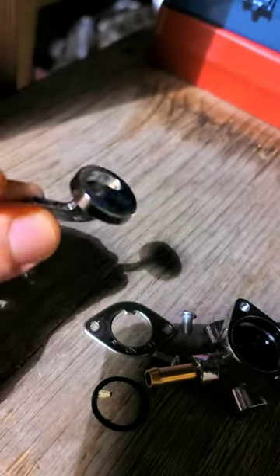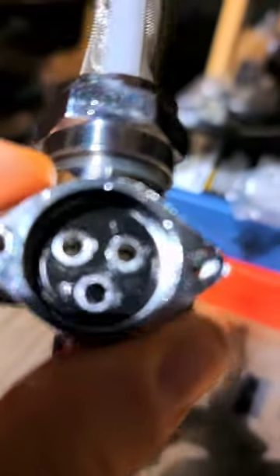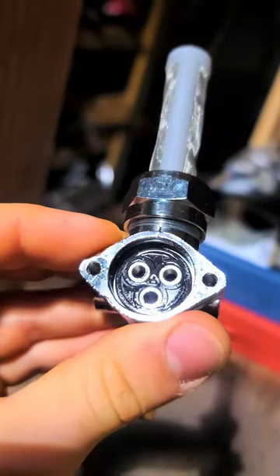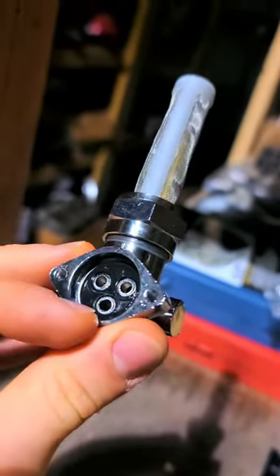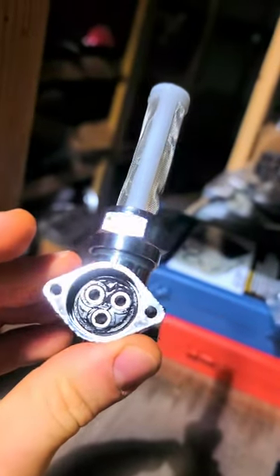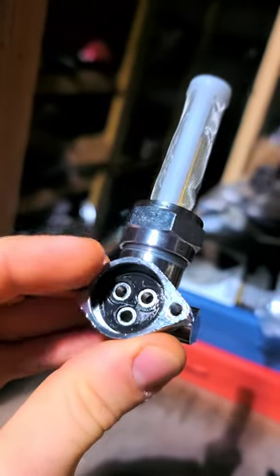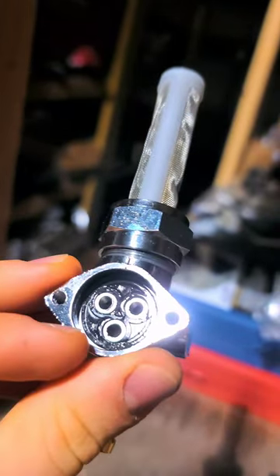We're going to pop that off, and now you're going to pop out an O-ring as well. The main reason the front right here leaks is because there's actually a rip in the seal. If you look at this one closely, there's some fraying in the seal. I think the lighting picks it up right there. So what I've done before is actually just flip this seal around. For some reason when they installed it, they didn't use enough lube — I'm really not sure the exact reason — but either way, there's a rip in the seal in the face, and that'll cause it to leak right off the bat.